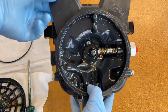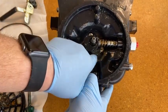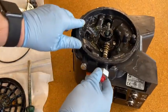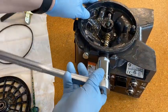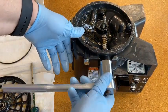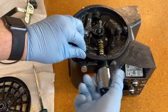Now we can see the three screws that hold the motor onto the base. We're going to want to remove the pump element as well, because there's a bit of interference where the spring could put the screw in crooked, and you don't want to strip the threads or cross-thread it when you put it back together. So let's remove the pump element. This is a one-and-one-eighth inch across the hex on the pump element. If you don't have that exact wrench, you can always use a crescent wrench. These come out pretty easily — even if seized, you won't have corrosion with a steel male thread going into a nylon female thread.